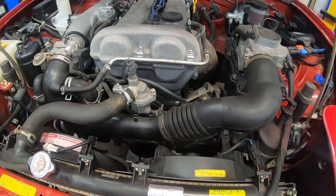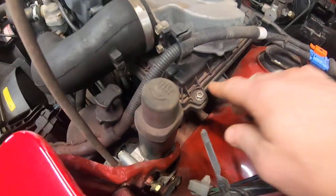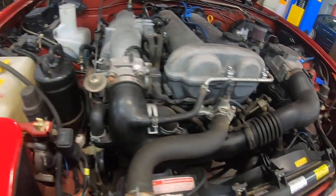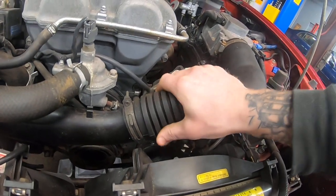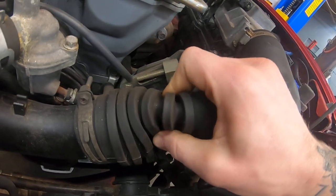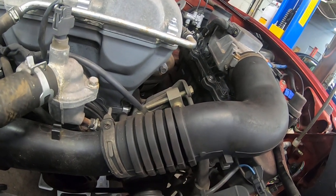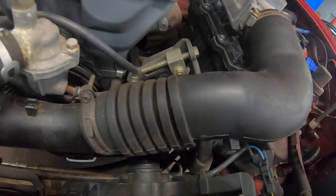Just like all other Miatas, you've got your crossover tube here. It goes from your air intake — the filter is underneath there, just take out a couple screws to get to your air filter. The crossover tube takes air from the air filter and air flow meter across to your throttle body. The 1.6s are unique because it's a two-piece removable design and the flexible section can get cracks in between the grooves. That causes unmetered air to bypass the air flow meter, making the car run lean. So we check that on inspections to make sure there are no hidden cracks.